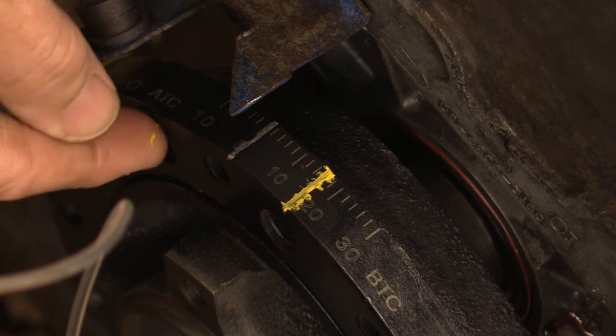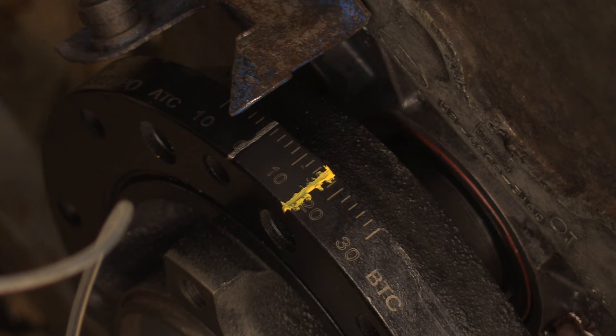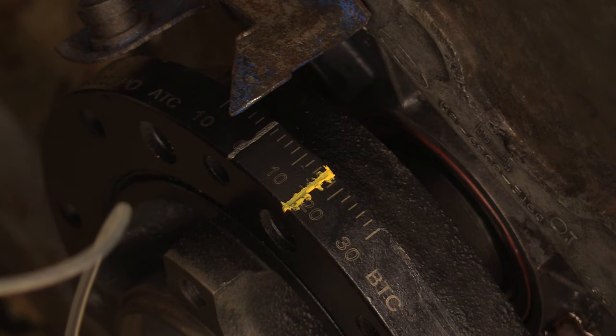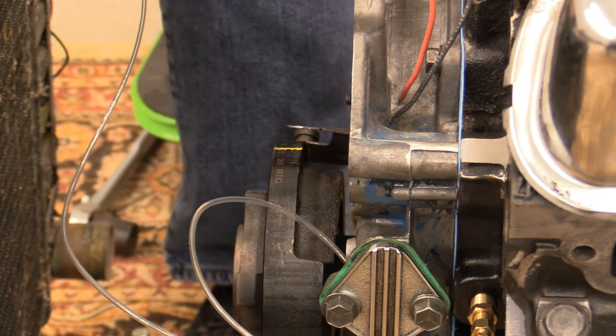When you're painting your engine, you'll want to cover this area with a piece of tape so you don't get any paint on your timing marks. I do this now because after you put the water pump on, it can be kind of a hassle to get down in there and mark them up. Right now it's right there out front, ready to rock and roll.